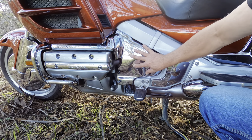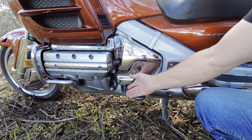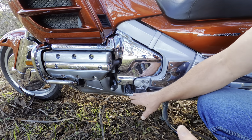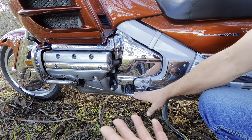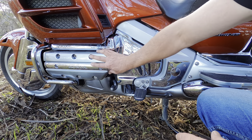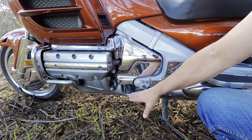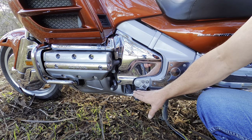The Gold Wing has a wet multi-plate clutch and a five-speed gearbox — though fifth gear is an overdrive at approximately 0.67 or 0.68 to one, with an indicator light on the instrument panel to tell you you're in overdrive. The sweet spot for this bike is around 140 km/h — 90 mph. It'll go right up past 200 km/h but you start burning fuel quickly. The compression ratio is about 9.8:1, so you don't need to run high-octane fuel, which in Australia saves you 20 to 30 cents per litre.